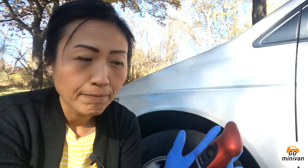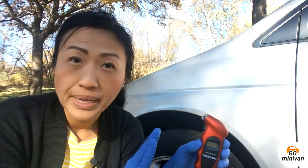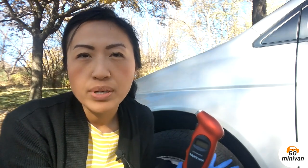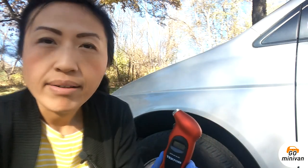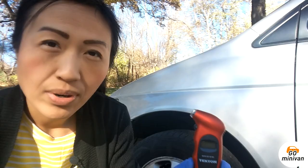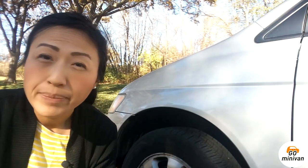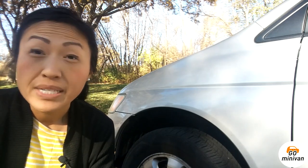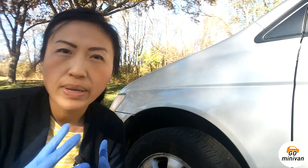I'm testing this for the first time. The batteries are included, which is great. The first thing you need to know is how much pressure your tire takes. This is really easy to find — you can find it on Google, but in our car it's on the side of the indoor car door jamb. It says front and rear tire takes 36 pounds per square inch. It could be different depending on any tire manufacturer's recommendation, so make sure you look that up.